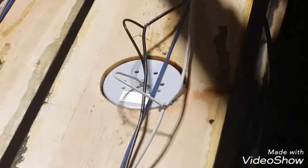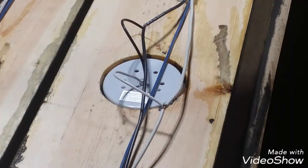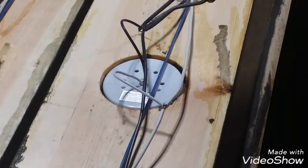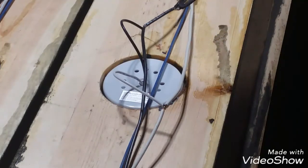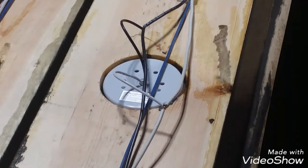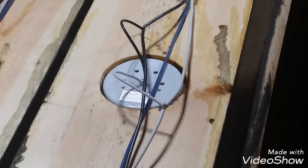We're going to take the black wire and we're going to wrap it around. Then we're going to grab our solder gun. We're going to wait for it to get hot. We're not going to sit there and hold it against the wire while this thing is warming up, because then all you do is overheat it. You've got to get in with a good hot gun, get it soldered, and get out, get done. Don't fiddle around with it. She starts smoking a little bit. All right, we're hot. So let's get in there.